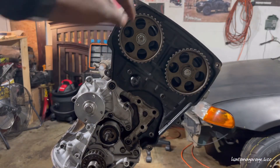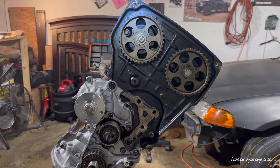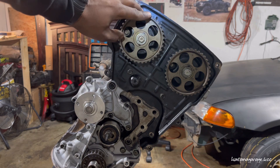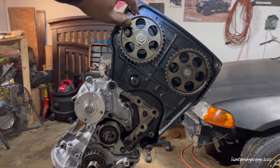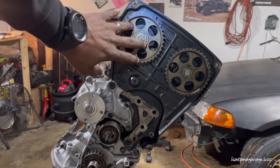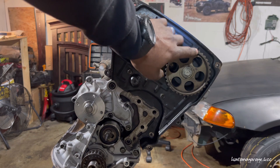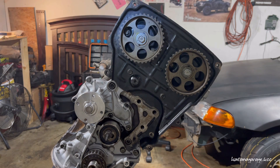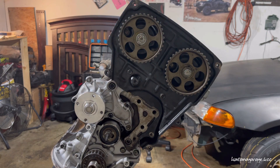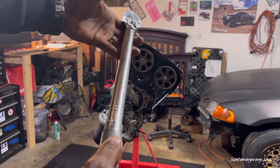You can see the notch is right here. So you've got the notch on the sprocket lining up with the little notch on the timing case itself — on the intake and on the exhaust you've got one notch on the sprocket lining up with the notch on the timing case. That's how we verify that the top end is in time.